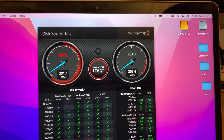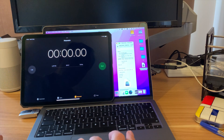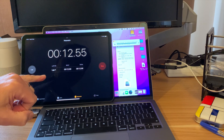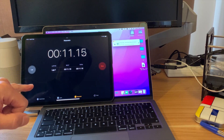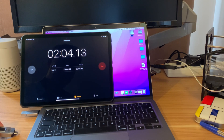But what's that like in the real world? I have a 3.6 gigabyte file on my desktop and I'm going to copy and paste it onto the Orico drive. Right-click, hit paste and start at the same time. You can see it whizzing through - about 12 and a half seconds. Now let's try with the Arcanite drive. Remember it was 12 and a half seconds before - and we're still way off at the end. Two minutes and three seconds versus 12 and a half seconds, so you can see if you're backing up large files it's really good to have a fast drive.